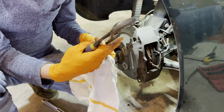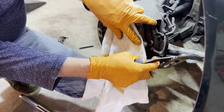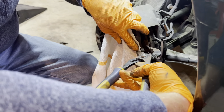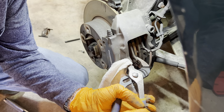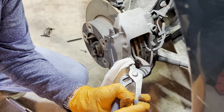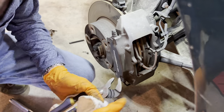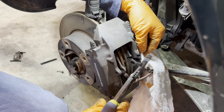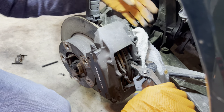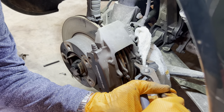I've got a little cloth to protect the caliper surface. What I'm going to do is just compress the piston — and it will gradually go in. You can feel it going in, all the way down to the bottom — that one's done. Same on the other side. Squeezing it in, it's sending brake fluid back up into the reservoir, which I'll show you in a moment. All the way in — no harm done there.